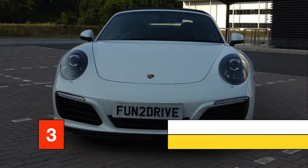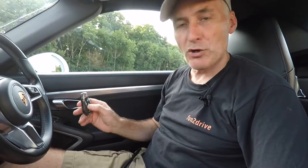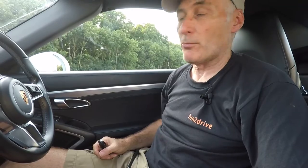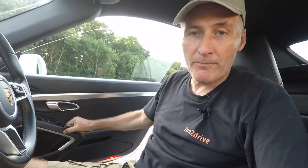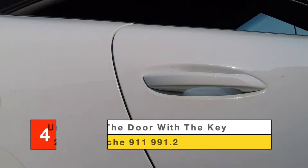The special feature with the locking: if you just lock the doors normally, that turns on the interior sensor and it also makes it so you cannot open the doors from inside — so anybody sat in your car at that time would not be able to get out in an emergency. To overcome this, all you need to do is press the lock button twice on your key fob. What this does is put it into a soft lock mode, which turns off the interior motion sensor and allows a passenger to open the door. Be aware the alarm will be sounded when they do open the door, but in an emergency at least they can get out.